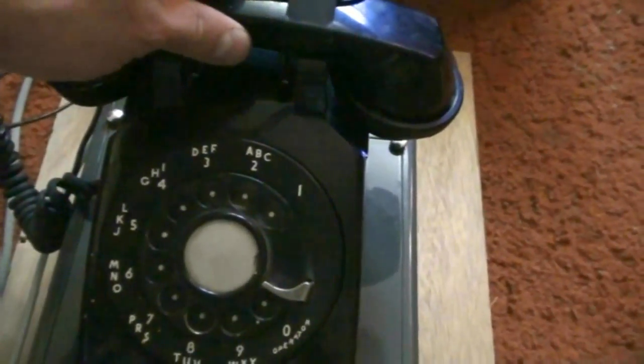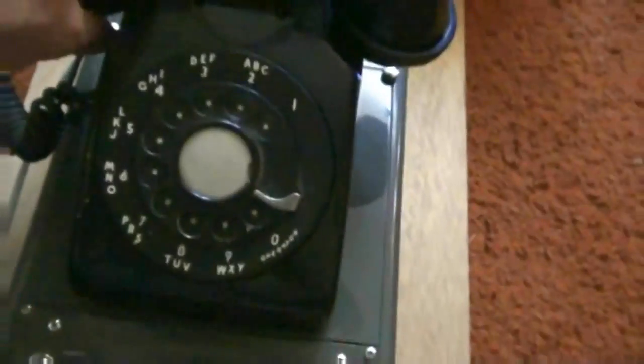Underneath the telephone here, you can see that little raised area — that's an induction coil that senses when the ringer is operating. These little arms here will actually lift the phone up and the unit will play the outgoing message, which comes from a speaker down in the cabinet, and the sound comes up through this little perforated grill to the mouthpiece. The conversation or incoming message is recorded through this induction coil that goes around the earpiece of the telephone.